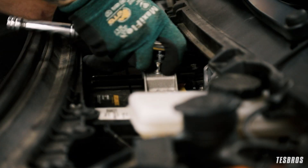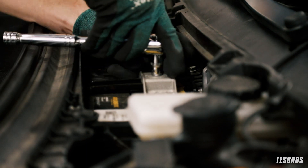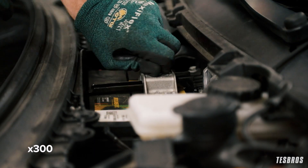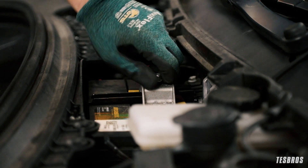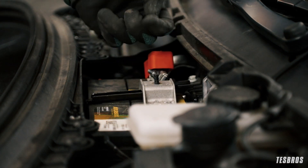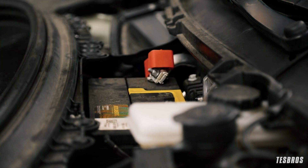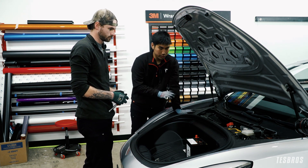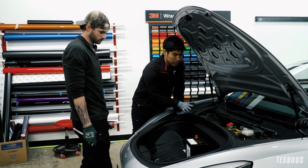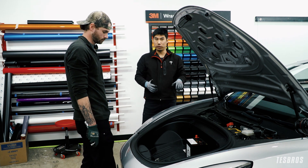As you can see, you're first going to remove the bolt that holds the bracket. There are different bracket variations depending on the model — Shawn from OMU does a good job explaining those differences. Just loosen that up, wiggle it around, and we like to put it up front just to keep everything the same. Remember, we've already disconnected the high voltage at this point.